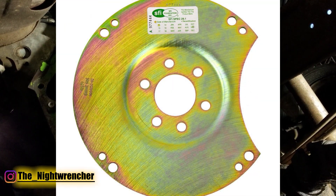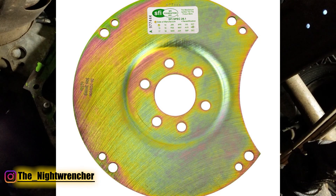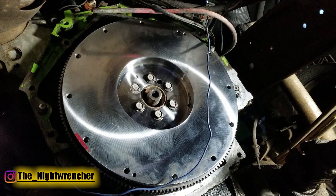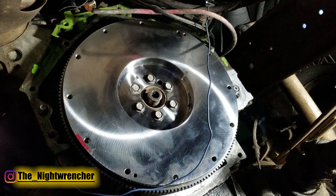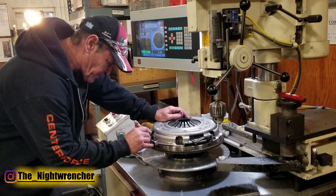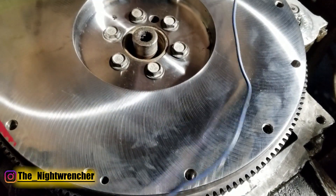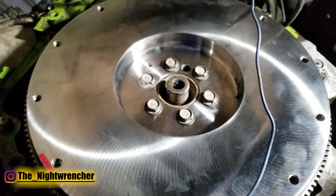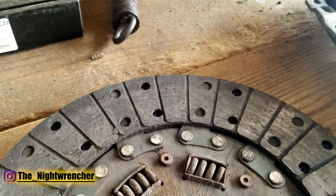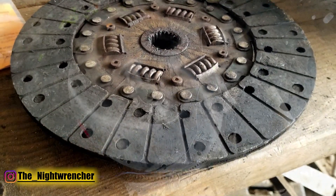If your engine is externally balanced, your flywheel is going to have to be installed in a very specific position because the bolt holes are not all in the same spot — so you can get the orientation of the flywheel correct. LS engines are for the most part internally balanced, so I don't really have to worry about that. One thing to note about my particular flywheel is that since it was balanced right after resurfacing, there's a mark that aligns the pressure plate to the flywheel. After setting the flywheel, I'm going to swap my gloves and wipe everything down with brake cleaner, since contaminants could damage your clutch disc and cause premature wear.